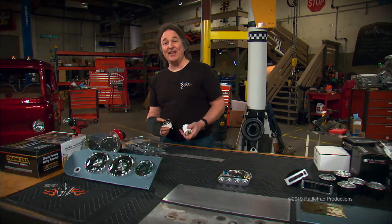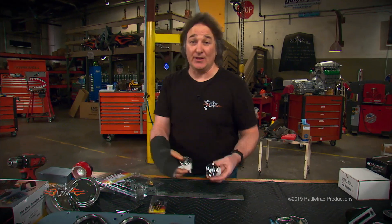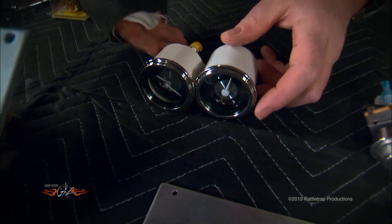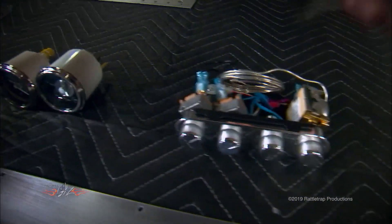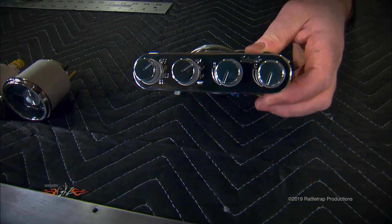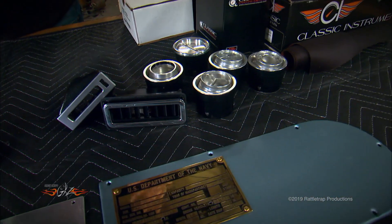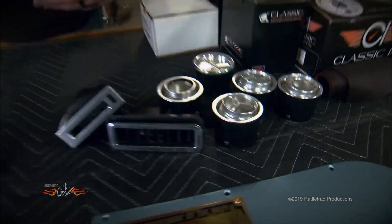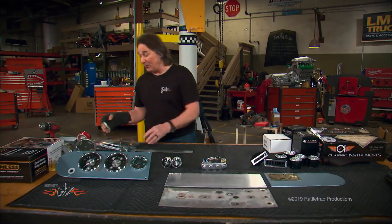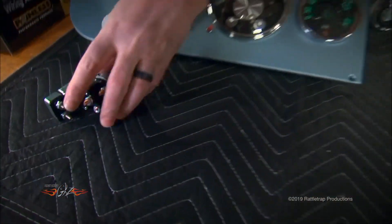A lot of times making a new aluminum panel is the simplest, easiest way to go. That lays out the basic gauges and panels. Now here's what we have to add: we picked up some extra gauges from Classic Instruments that need a place, we're adding Vintage Air so we need a place for the controller, and then we need to choose some vents and find a place for those — you can get rectangular vents or round vents, just depends on how you want the panels to look.